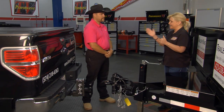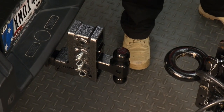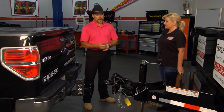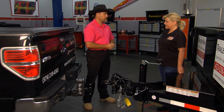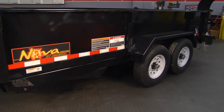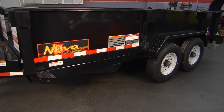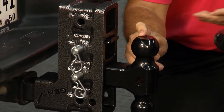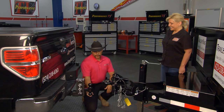This week's Gen Y towing tip of the week — we're going to talk about versatility and reliability. Tracy, who's a national sales rep for Gen Y, you can tow all kinds of stuff with your hitches. With Gen Y hitch we want dependability and versatility, and because of that we reduce liability. A lot of people don't think about it — they think, 'I've got a 2-5/16-inch ball, my trailer's 2-5/16, I've got a truck with a receiver, I'll back up and hook up.' They don't think about weight ratings. So with our 2-5/16-inch ball we're rated at 16,000 pounds on a 2-inch receiver, which up until we came onto the scene was unheard of. On the bottom side I've got my 2-inch ball, so I have the versatility of two on one.